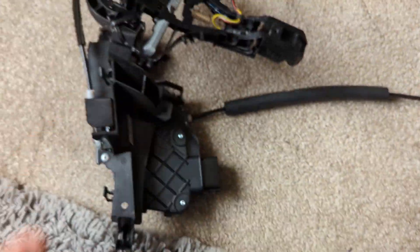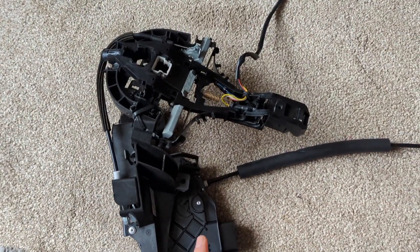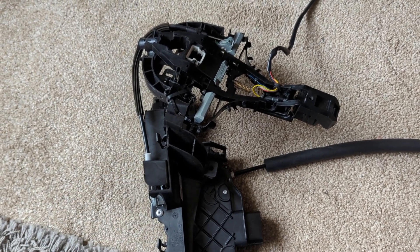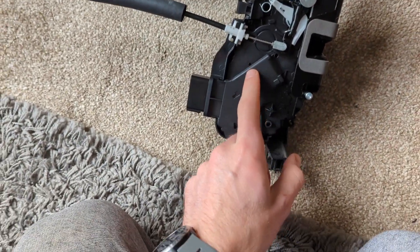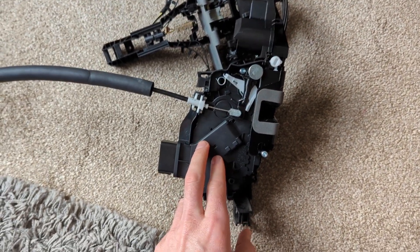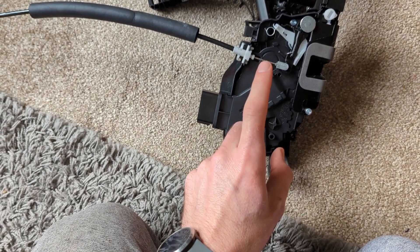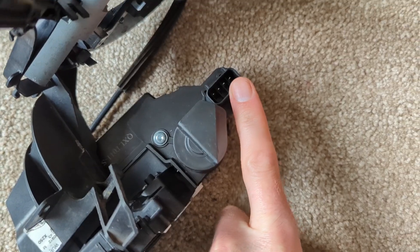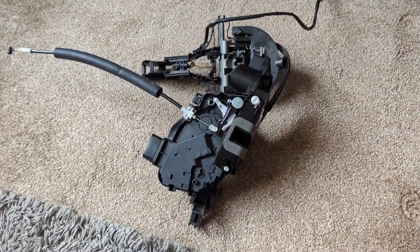I was debating whether to buy the entire set new, but I couldn't find them very easily available. The door locks on the inside of the car weren't working, but everything else did — the key worked, the remote worked, and walking up to the door and pulling the handle was disabling the alarm. So it was just the inside part. The new part is listed on eBay as an X260 part — the later shape XF — but it looked visually the same as the one from my X250, and it's also listed for keyless entry where some others don't. The difference is a 10-pin plug and a 4-pin plug, so I'm hoping it will fit exactly on the X250.